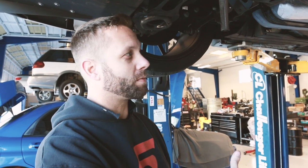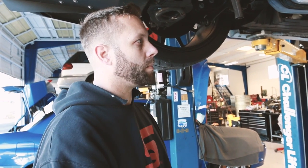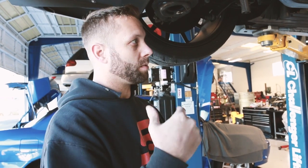When I show you everything moving under power you can see why drivetrain loss-wise it's very minimal. We've dynoed it and it comes out to the same power — just kind of debunking the idea that putting it in front-wheel drive mode makes more power. You're running a Mustang dyno, which is a fairly conservative dyno that doesn't put out inflated numbers. We set them up to do real-world numbers — they generally do run lower, but you can adjust the dyno to read whatever. We keep the factors the same so what the car puts down on the dyno matches what it would trap at a drag strip.